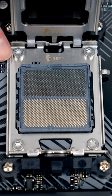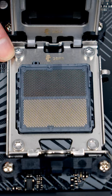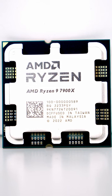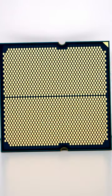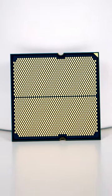You'll notice that the pins are now on the socket rather than on the bottom of the CPU. If we look at the top left hand side, you'll notice we've got a little triangle which we're going to line up with a mark on our CPU. There's a gold triangle at the top left hand side of the CPU which is going to line up with the triangle on our socket, and if we turn the CPU over, you'll notice we don't have any pins on the other side of it.